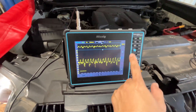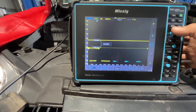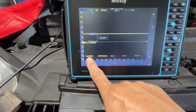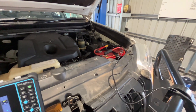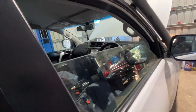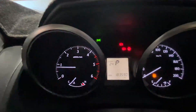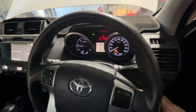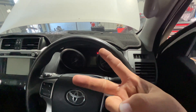I'll check also the voltage of this one. Yeah, it's only 9.2 volts. The charging is only 9.2 volts — it's meant to be 13.6 or higher, but this one is only 9.2 volts. The battery indicator is on also. So yeah, I'll turn this one off and replace it with the new one to see the voltage and ripple test difference between the two.